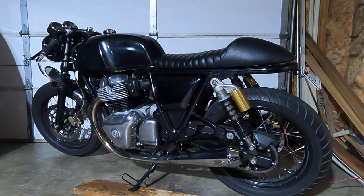So after that, once I had the Revelry Racing map in there, I started doing 0-60s, and I'm going to give you all those times here in a minute. And I realized first gear was just instant redline on this bike with that map. It bucked a little. You had to be careful going out from first gear on that one. You immediately redline, you shift to second, your second pull is really good, pull it really hard, but it doesn't get you to 60 miles an hour. So you got to do another shift just before 60, like probably 56 or 55 miles an hour, because you hit the rev limiter.